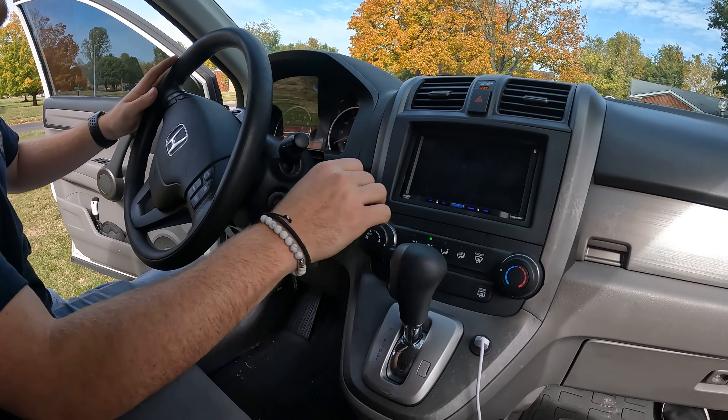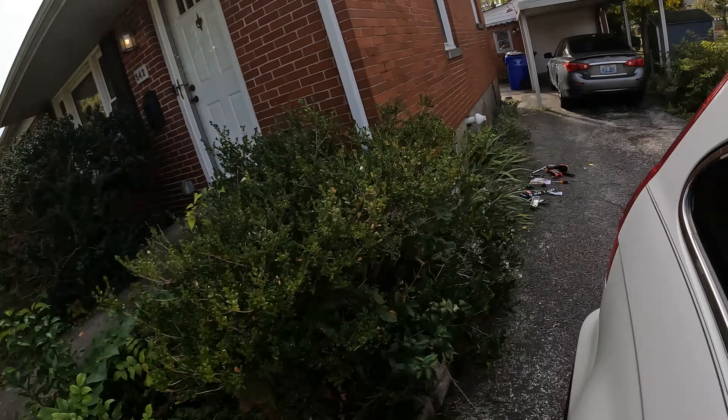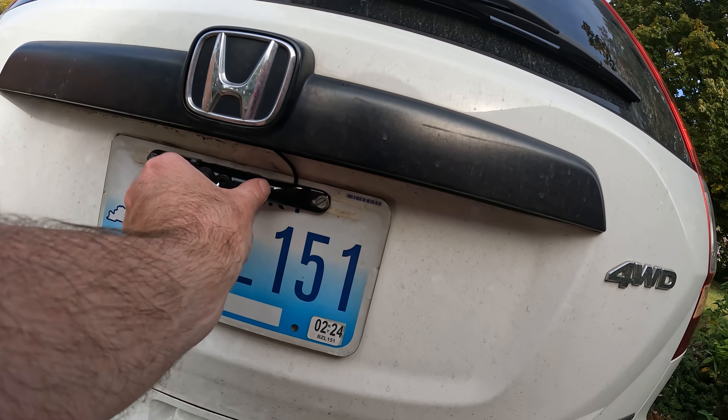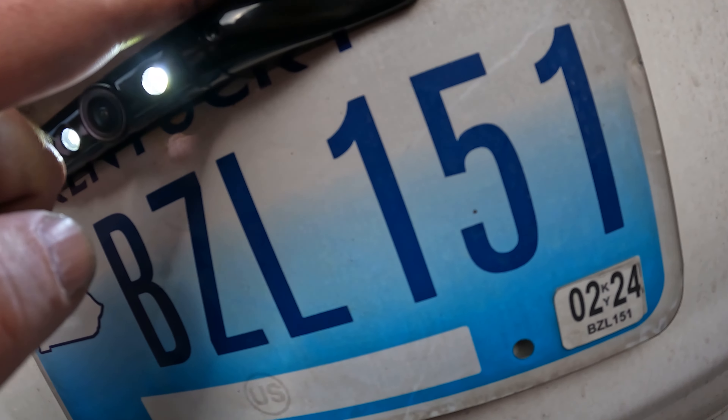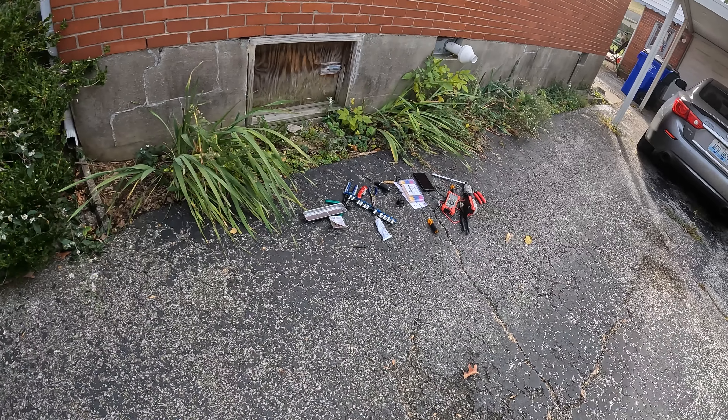So we got everything mounted. We actually took this out and adjusted it. If you notice those mounting holes in the mounting bracket are slotted, so you can pull it in and out. It looks a lot better — it's pretty flush here and here, but in the corners it's not. So if you pulled it out more, this would stick out. It's aftermarket, so it's not going to be universal. We took this clip off and it actually had a window mount for the microphone. Chase fed that down through there. He's putting all the plastic back. We got the backup camera in and the only wire you can really see is up there. So we're done. The backup camera works and it's got LED lights on it too, for nighttime. We came through the license plate light. I'm pretty happy with how this turned out.